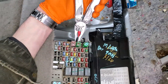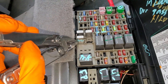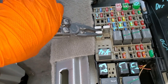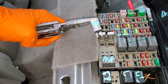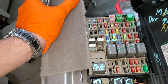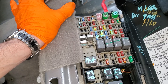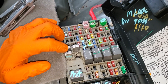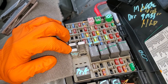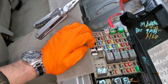Now as far as the fuses go, a lot going on. I'm gonna first talk about not a fuse but a circuit breaker. This one provides power for the windows to roll up and down. The reason why they use a circuit breaker is they want to give the car an ability to take a rest for the windows but then get it reset. There's no good way to test that without a voltmeter, although I would recommend you could swap in one of these other ones as a troubleshooting step — these are for the power seats.